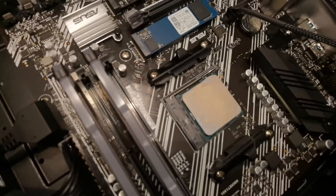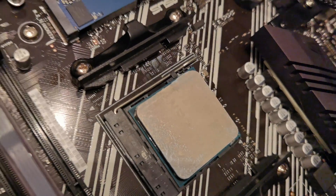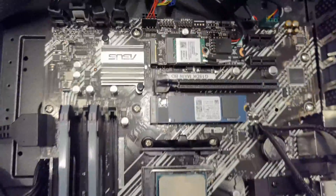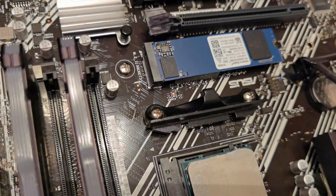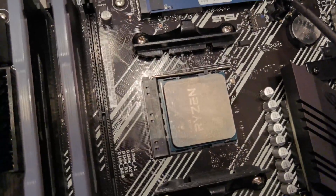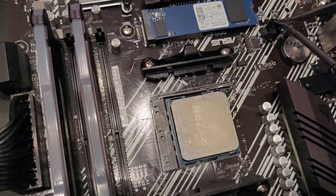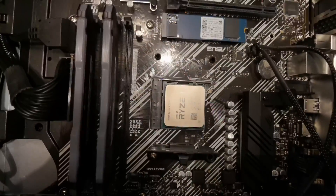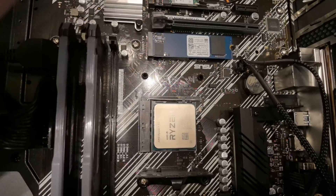Okay, we're back. First thing you want to do is remove the thermal paste. I had to reuse thermal paste basically the previous time because I ran out - that's why it looks messy like this. I'm gonna remove it, and then you need to remove these. Those are OEM brackets they come with on these AM4 socket boards. Let's remove these four. And there's a back plate underneath on the other side of the board. This back plate you want to keep for mounting the Noctua, actually.